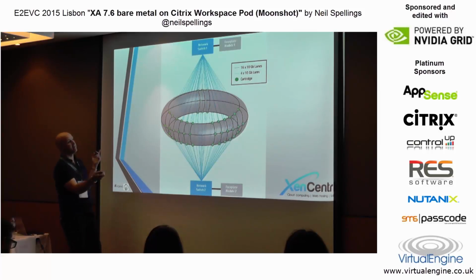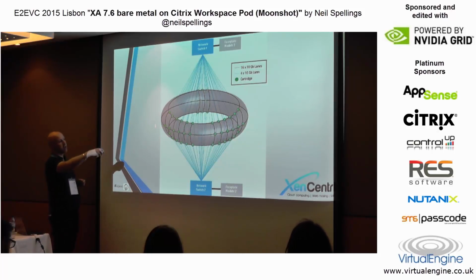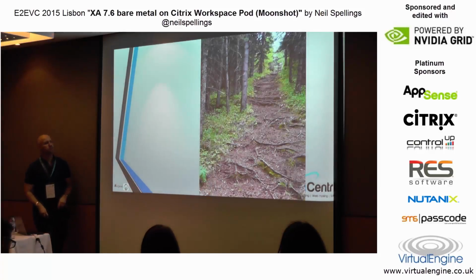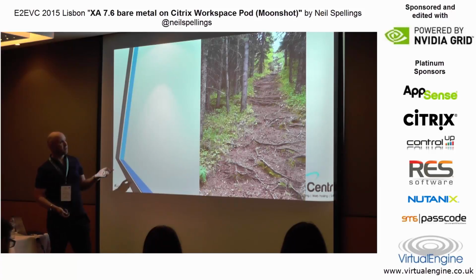The reason it can only connect to 4 is if you look how the backplane in a Moonshot system works, it's a toroid. So each cartridge can connect in this kind of shape, all in a nice toroid. So that's why the PCI bus only gets exposed to the 4 surrounding cartridges. So that wasn't available. They only just released that. I'm not sure if you can actually buy it, but it's listed, but they might not actually have it yet. But I've been testing one; it's quite useful.